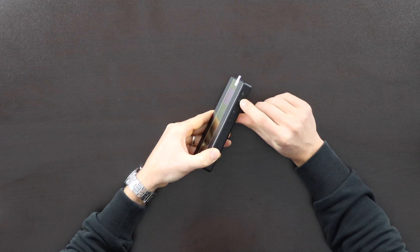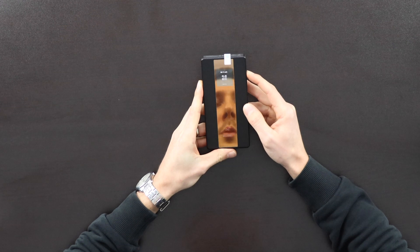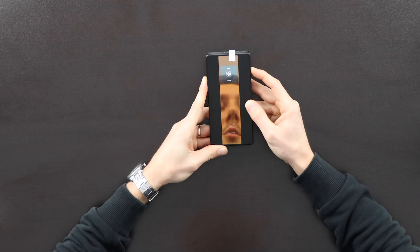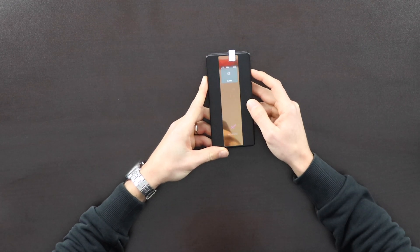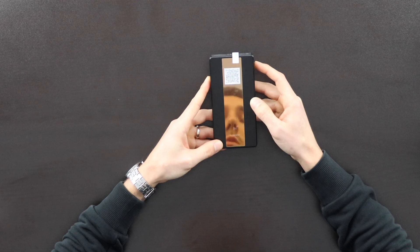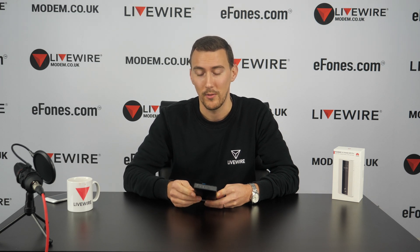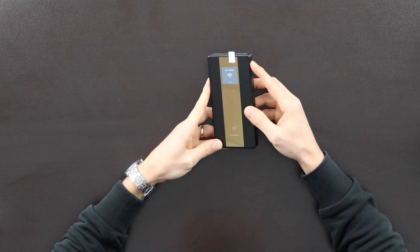You've got a power button and an enter or cycle button. On the main screen, press that little dot button to go into the device menu - you'll see Wi-Fi code, Wi-Fi settings, device information, and more. To enter any menu option, hit the power button. For example, going into Wi-Fi code and pressing the power button gives you a QR code - with most mobile handsets, scanning it with your camera takes you straight to the Wi-Fi connect option.